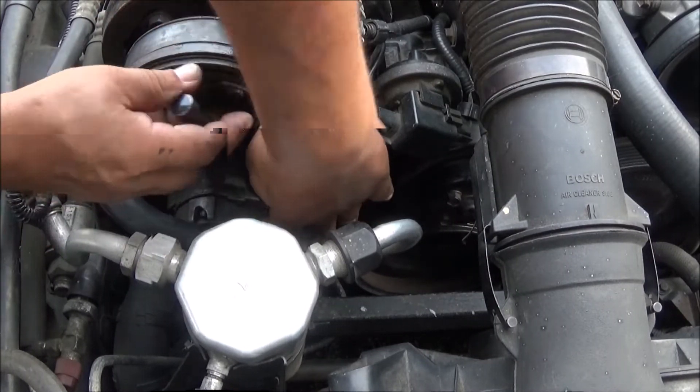Now that that's out of the way, everything's good. We're just going to move the belt off to the side, and get this nut down here that attaches it to the block. We may have a tight fit. Since this car has been known to throw me a metric every now and then, I grab my metric wrench set. And that's exactly what it is — 15 millimeter. We want to go towards the passenger wheel.